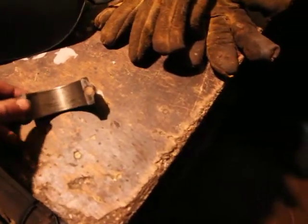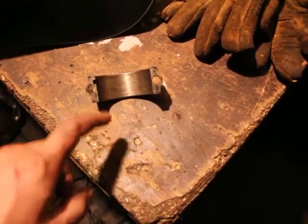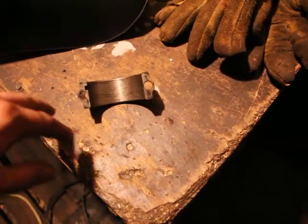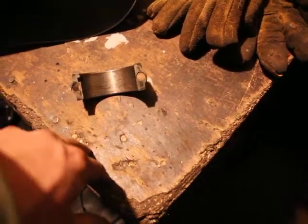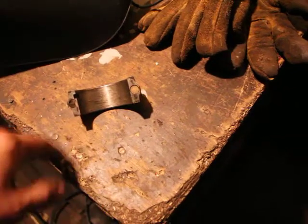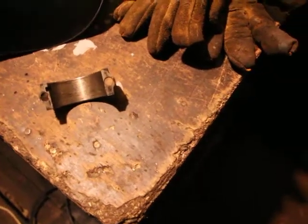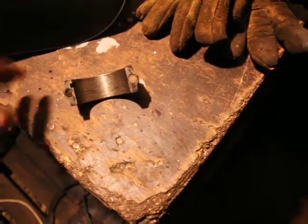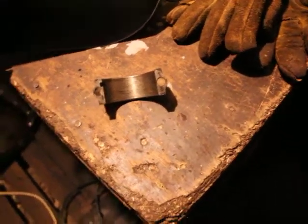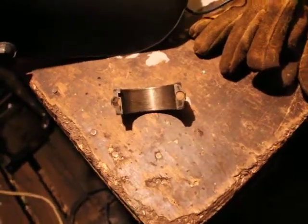But I'd like to say that it's actually always better to use thinner oil. If you're not sure, it's better to go with the thinner oil than the thicker oil, because the thinner oil will lubricate better. Right? Because it's able to go into those crevices more, at least in these cars. I probably take back what I said. In these cases I'll stand by it, but it may not be the same in all cases. If you have too thin oil, then you don't have enough protection. There's too much friction there. So it's a bit of a two-way logic.